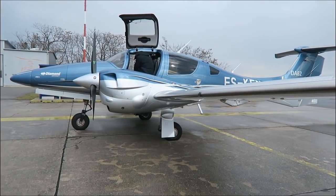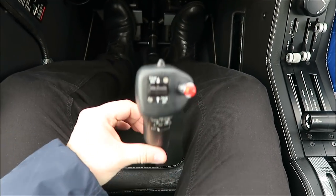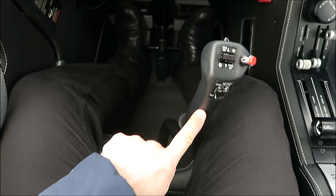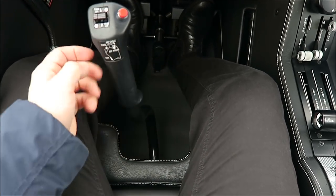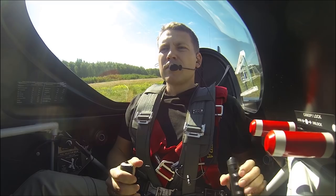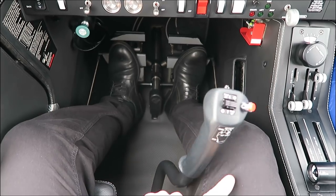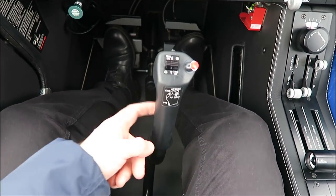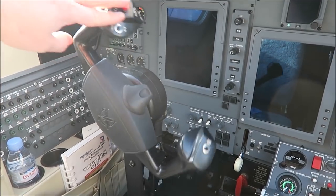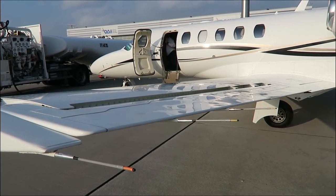Let's have a look at this Diamond Aircraft DA62. It has dual stick controls. On the ground the stick is maintaining its position — staying wherever it's left. This happens because of the weight compensation of control surfaces, tension of cables, and friction in all pivot points. Same story with the yoke of this Citation jet or with the stick of this aerobatic Extra 330. It's actually a pretty nice feeling when there are no undesirable self-movements of the stick and you need to apply some force to move it. The amount of this force is very easy to control.